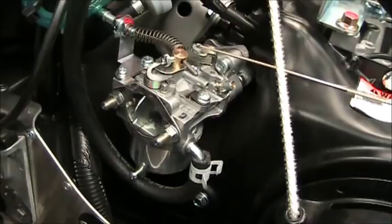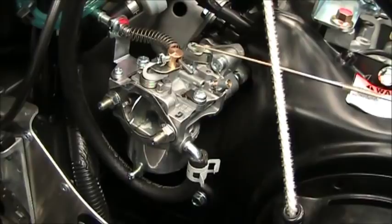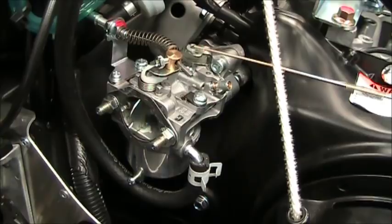You've got your normal little butterfly carburetor like the 120s, but they changed it. This carburetor is actually bigger than the standard equipment carb that comes on this engine. So boring the carburetor really isn't advantageous for more horsepower when it's in stock form.